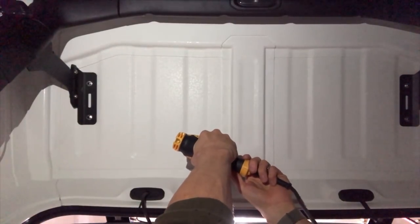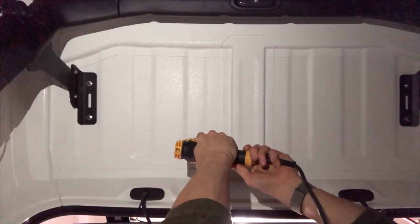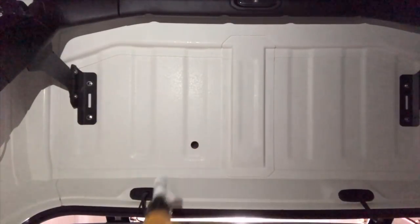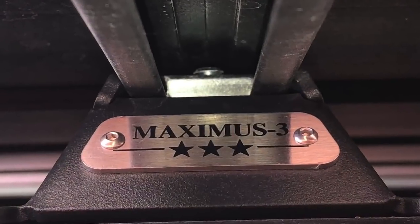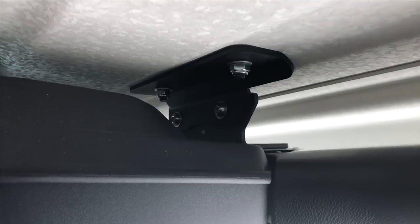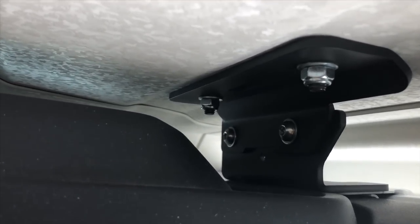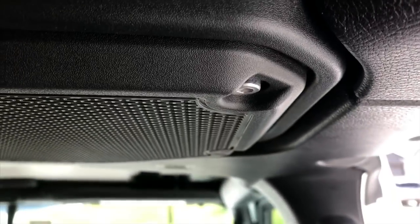This isn't really an installation video, but I will go through the highlights. To install this rack and the brackets, you do need to drill eight holes in your hardtop. This hole here was drilled to allow for wiring access for the lights. There are four low-profile Maximus 3 brackets just underneath the roof rack that attach on the inside of the hardtop at four separate mounting points with two bolts each — and at the front, it mounts right into the sport bar, so all the weight is supported by the sport bar.